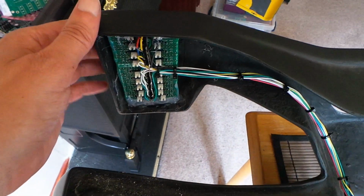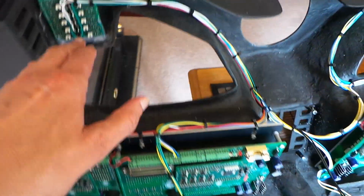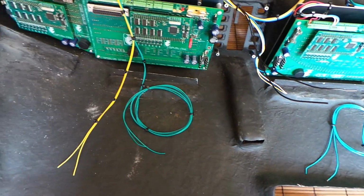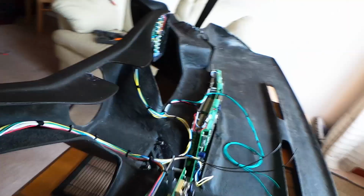All of the other switches on the switch pods, apart from the horn switch, are for controlling the push buttons and the switches to each dash module. The top switch on each of the switch pods isn't wired to anything, but I do bring out the connections on a pair of green wires so that can be used in the future for anything you care to connect it to.